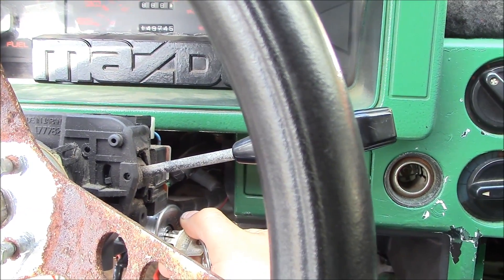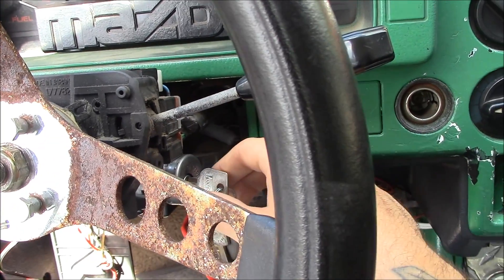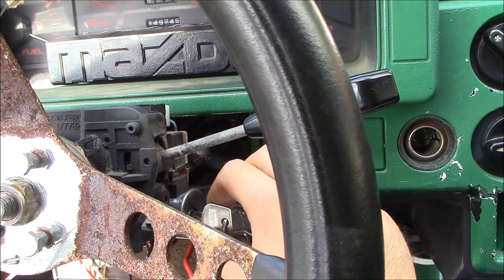It's been a while, I know. But have you ever ran into a problem where your V8 swap — whatever it be, S10, Ranger, T-bucket, maybe even your Mazda — doesn't shut off when you turn the key? We'll use this one for example. It's on right now. Still on. I'm going to show you how to diagnose an alternator back feed and how to solve the problem.